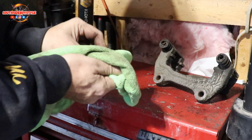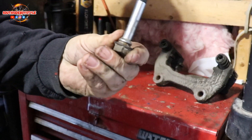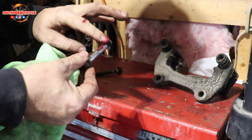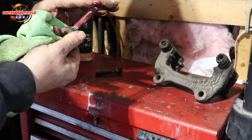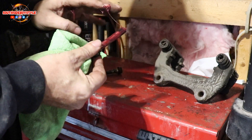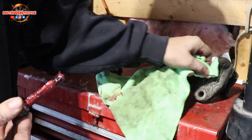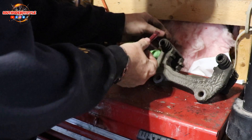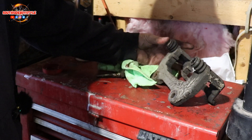I'm going to clean all this up, wipe off all the excess grease. I don't have to get sandpaper or anything for these because they're in really good condition anyway, so this is just a re-grease and an insert back in. As I always say, if there's something I can do to make it easier for you guys to do a job, I always do it, and I always stress about sliders because it's the most important thing on a brake job. Look how free that is — that's what the caliper is sitting on, both sides, it has to be free.